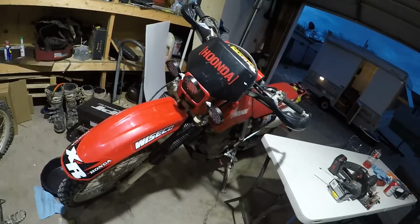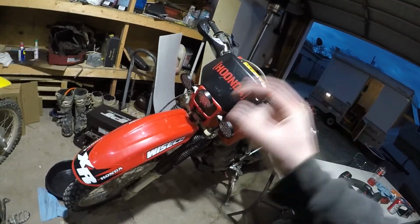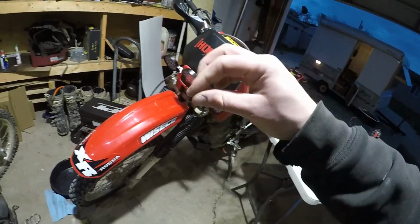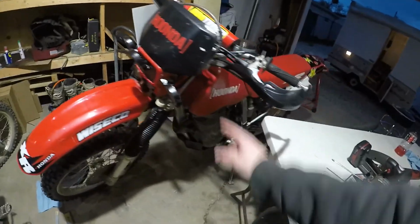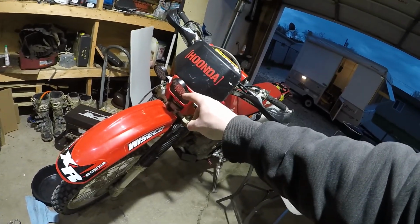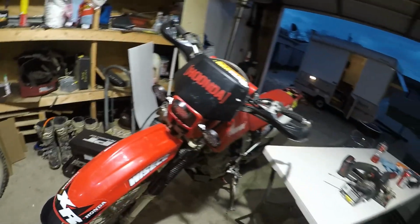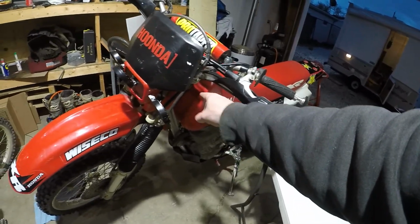That usually happens right away. And I believe the individual really small breadboard LEDs, those diodes will probably go immediately. But the regulator does a good job of keeping the voltage from spiking over 12 volts, because that would blow the original incandescent bulb that was in here. But anyway, this is just running off the stator into a regulator and then right to here.